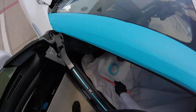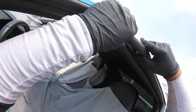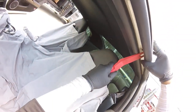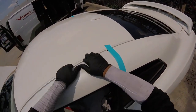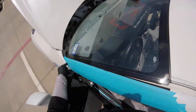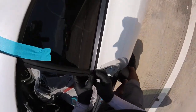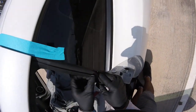Okay, and now, it's doing this because we have a little clip, the same as the Mustangs or the Infiniti, because the Mustangs have the same thing. It's right here, okay? So the only thing you have to do is open a little bit. When you get it out, this guy is easy. Even with your fingers, you can remove this guy. Okay, now remember this hook right there. You need to have this double face tape because you're gonna reuse it again.